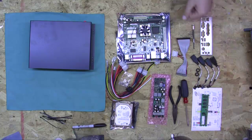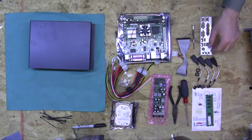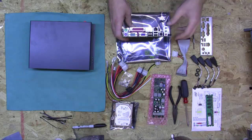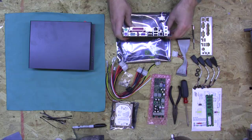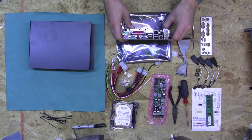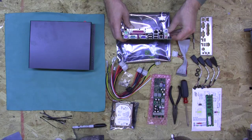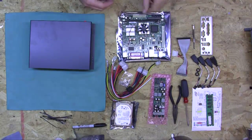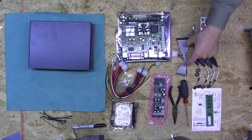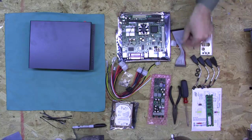Of course, we have a memory stick — in this case we're going to use a 2-gig memory stick. The sticker that's going to go on to describe all of the ports is underneath. We're also going to add four extra USB ports. This motherboard comes with four ports, but there's a lot of situations where four is just not enough. Using hubs can get quite unstable when you're turning the computer on and off and you just want devices to work without any keyboard input. It adds a lot of stability to have non-hubbed USB ports, and you also get a full 500 milliamps of power out of each one. We have a back plate which we're going to modify in a little bit, and a 2.5-inch hard drive to standard IDE connector, which plugs in here when we get a little further into the install.